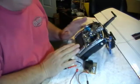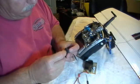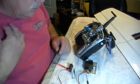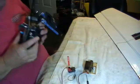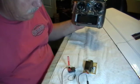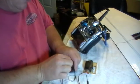Okay, got my radio set up with my Edge 540 named and everything. So now we're going to take a receiver and put the bind plug in where the bind battery goes, and then we'll plug a battery into any other outlet. This is a JR Spectrum system that I use. Futaba's a little bit different. Okay, got our blinking light. I need to turn that off now. While I hold the button in on the back of my radio and turn the power on, the light will go out. It starts blinking slow. Go out again. And then on solid. There we go. We're linked up. Ready to go. All right. Pull the bind plug out of there.